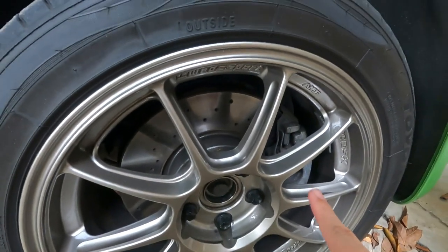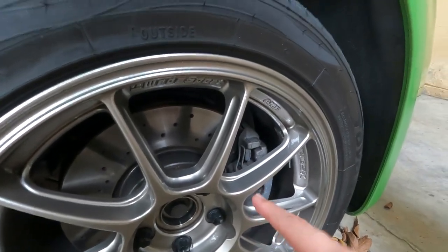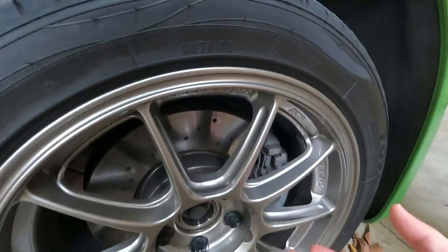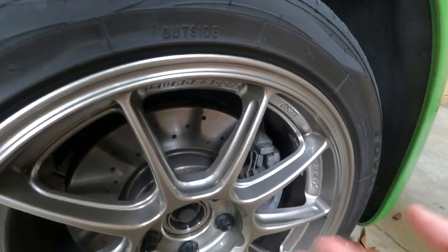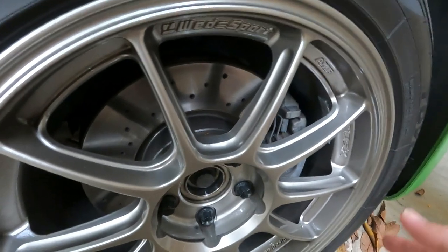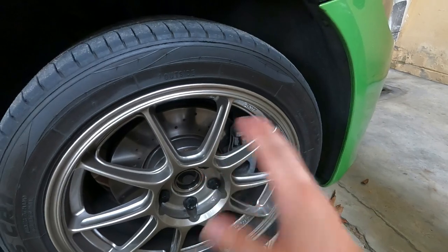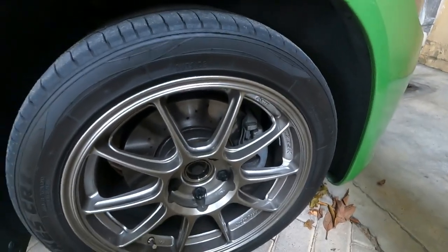This side did have an issue — I had to change the wheel bearing because the track on the inside of the hub was worn. I'm not sure why since I'd already changed the bearing once before. I had to do it again and spend another 300 ringgit, but what needed to be done has been done. I didn't want to modify the brakes too much, so Brembo extras for the win.